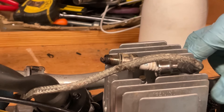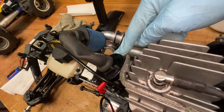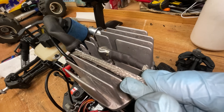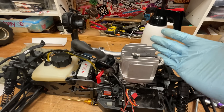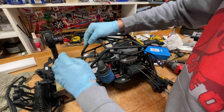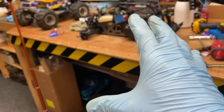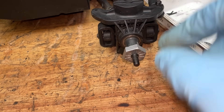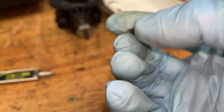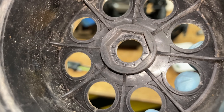And if we pull this, we should see a spark. Yes! So this is the best way that I could find to route the wire. I don't know if it's going to be a bad idea in case it gets hot — if anybody else has got any better ideas, let me know. So one of our biggest hates with all Savages are these stupid little wheel nuts. These are supposed to be 17 mil hex and they're not really. You can never get them on tight enough and you forever have troubles with these hexes rounding off.